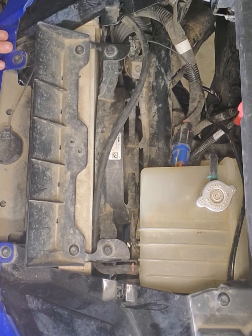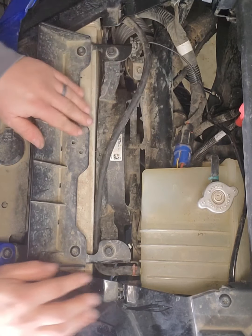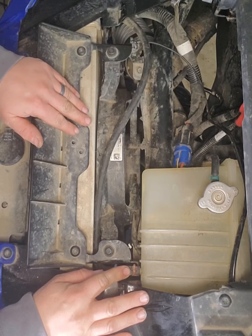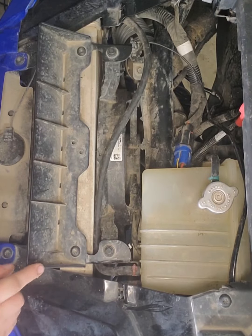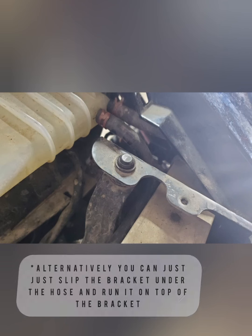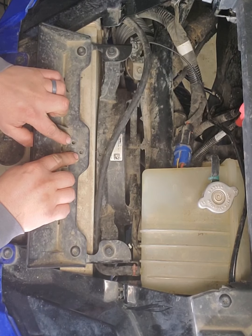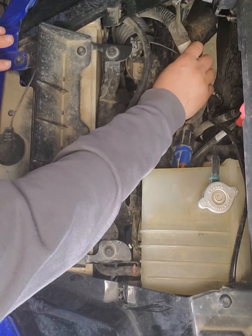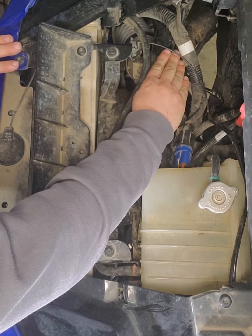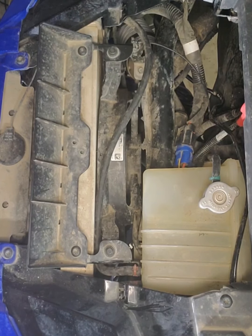Alright. So now that we're over here at the RZR, I went ahead and did some housekeeping items to speed up the video. What I did was I unhooked the coolant line reservoir hose that usually runs up here. I rerouted it below and back onto the bottle. Remove the zip tie retainers that sit here, and you will have to make sure everything is low. So what I had to do is I had to cut the zip ties for my voltage regulator wire loom, shove it over, and I will re-zip tie it once the installation is complete.